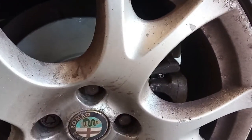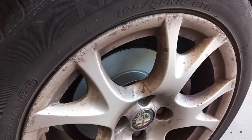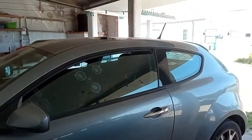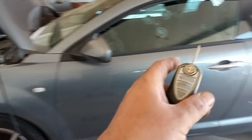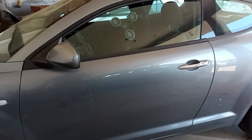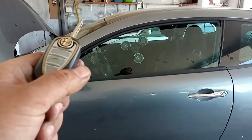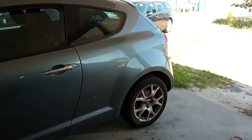Also notice the new rear brakes — they seem almost like plastic discs but they are ATE brakes and pads. Everything was nice on the assembly. If you want to know how to bed in these brake rotors, I have a video in the description. After connecting the battery, wait about 5 to 10 minutes before doing anything. Then close the car, open the car, open the door, do the ignition, and drive. Only then check if the steering wheel is straight, do wheel alignment if necessary, and then calibrate the steering angle sensor.